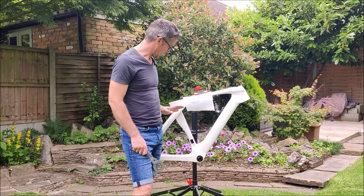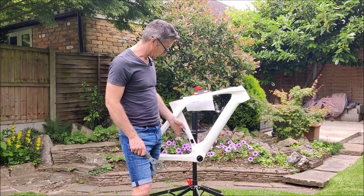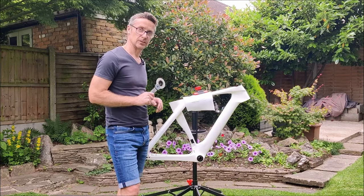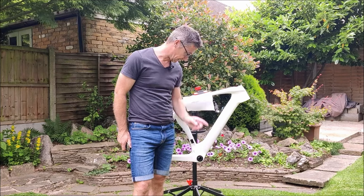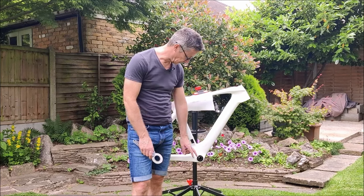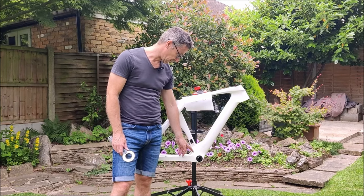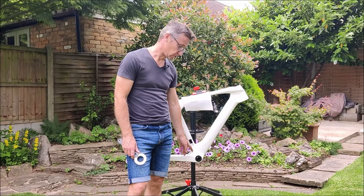Right, let's crack on with this. I've got the bike frame in the stand - not ideal to clamp on the top tube with carbon but I've got it quite gently. It's not feasible to clamp to the seat post tube because I need to put the battery in there for the shifters first. With regards to the bottom bracket, I referred to it as a T40 earlier but it's actually a T47. My Shimano bottom bracket tool won't fit this one so I'll have to get another tool.